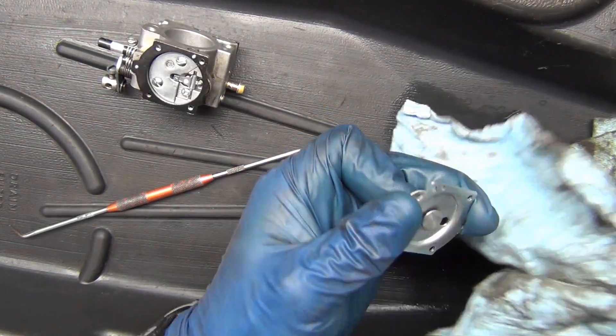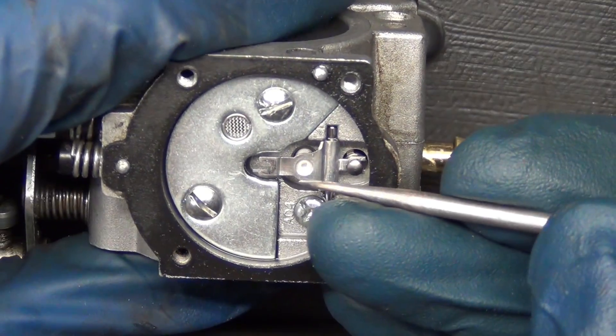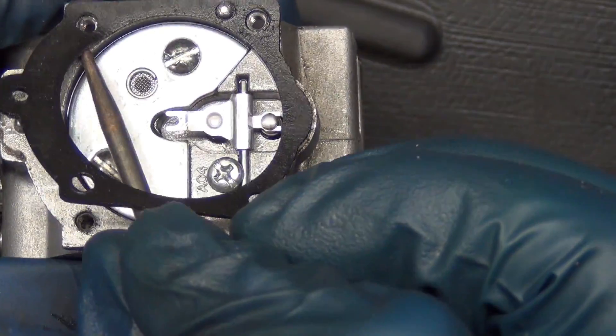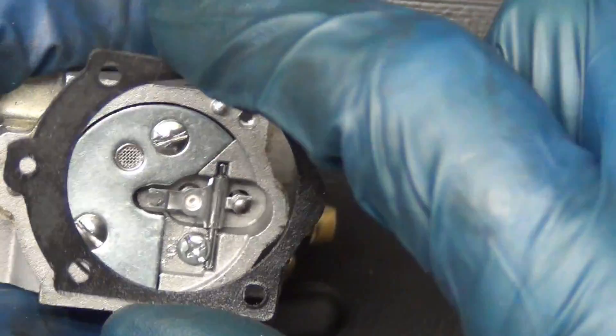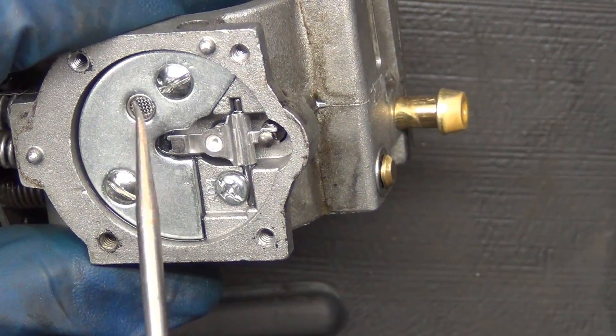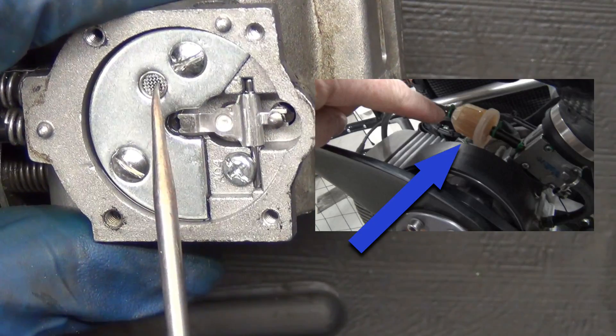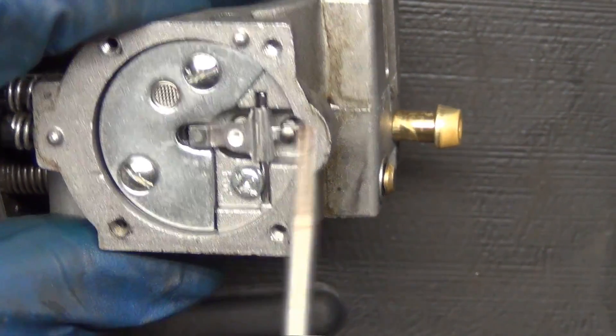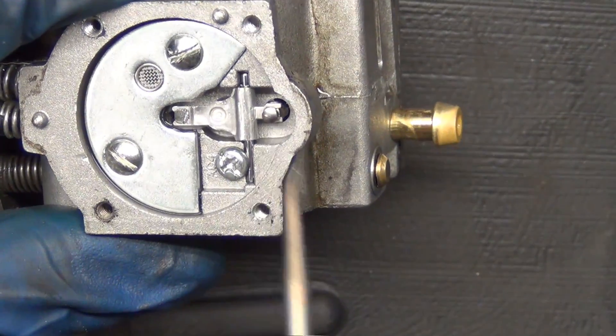Things work so much better once there's no sand in it. This is what's under the diaphragm — you've got this gasket. I'm just going to put this in the same orientation on the paper. Now this screen here is in great shape. I don't have any blockage because I use a fuel filter, so I'm not going to worry about that. I am going to replace the needle and seat on this because the tip of the needle can get worn out.